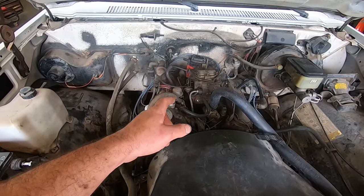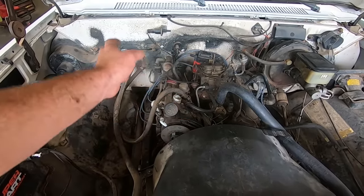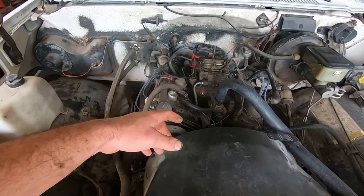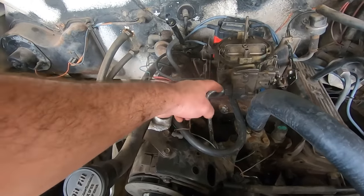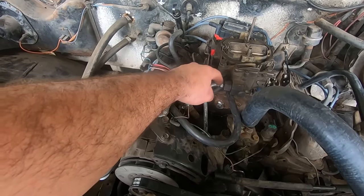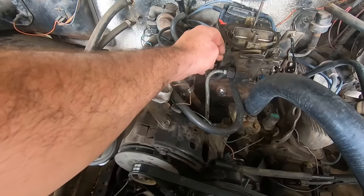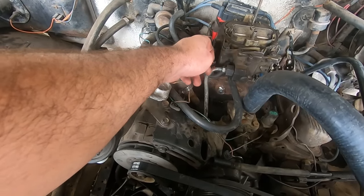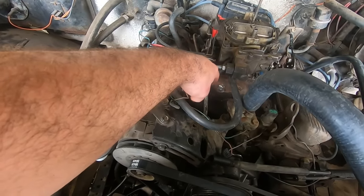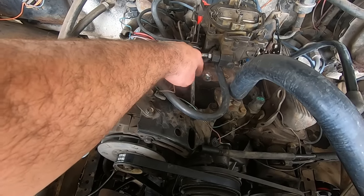But here's my resolution. I got this floater Quadrajet that I just throw on stuff because I know it works. The fuel inlet comes in a little bit different spot. That's why I took the filter inlet fitting off the other one. I was thinking it was longer. That's not. So it's all just moved over a bit here, but there was some EGR probably right here. Big old canister was in the way, so we deleted that.